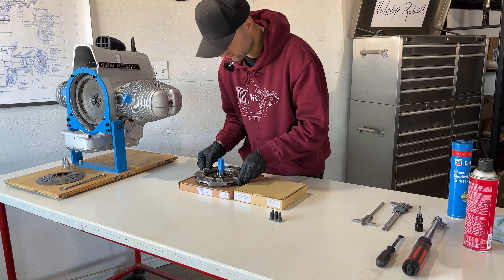Remove the M8 bolts and install three additional Allen head bolts. With all six bolts in place, use a torque wrench set to 16 foot-pounds or approximately 21.5 Newton meters. To prevent the flywheel from rotating during torquing, block it using a rubber pad and a small pry bar engaging on the ring gear. During tightening and torquing, make sure the clutch disc stays centered to the clutch pressure plate at all times.